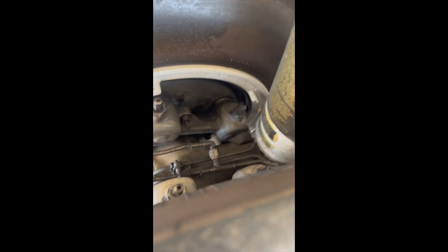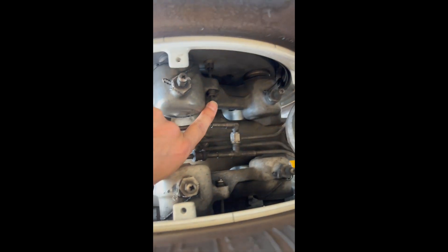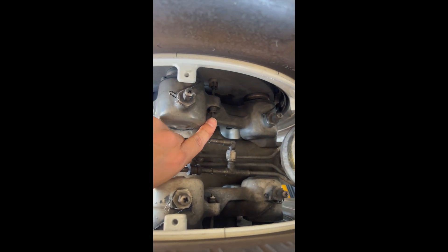Check the wear of the tires — do the same thing with all the pads. Right here you can see the indicator that's going to tell us how much wear is on the brake pads.